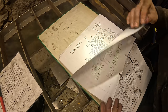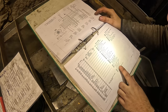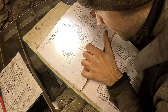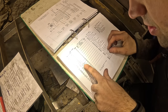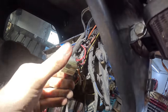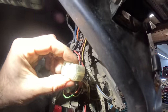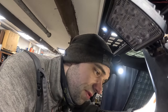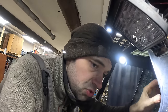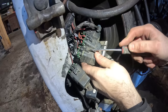Let's check here the gap diagram. Glow block light number 21. Wire 28. Blue black. Different. Yeah, it's not blue yellow, it's blue black. Blue black, where are you at, my man? Oh, here you are. So we got a blue black here. It's not connected to anything. So in theory, if everything is nicely connected, this blue-black should be direct connection to the blue-yellow at the relay switch.